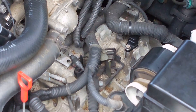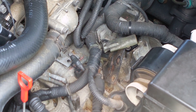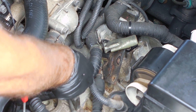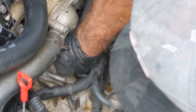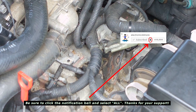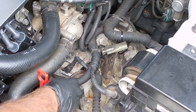For the input sensor, I'm going to loosen the two 12-millimeter bolts holding the metal plate onto the top of the transmission — this gives a lot of clearance to work on the input sensor. Same thing: clear away any sand or debris around that sensor. Compressed air works really well; if you don't have it, you can blow the sand and debris away through a hose held to your mouth.